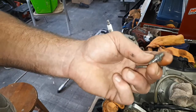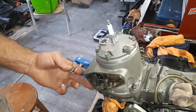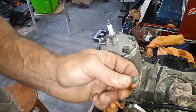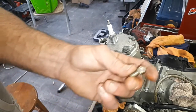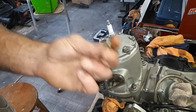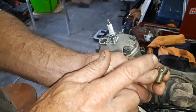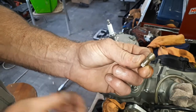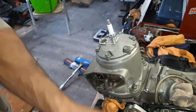Put in the little spigot drains for the crankcase breather and power valve cover breather. I'm going to put a little bit of Loctite on those just because they've got a bad habit of coming loose. And then just the ball coupling on the power valve actuator arm. With it out, you can actually see the little hole in the back where that funny little clip goes up through there, and then it clips around here. So yeah, just easy to see that while it's out.